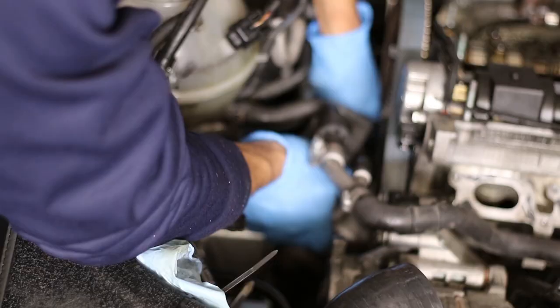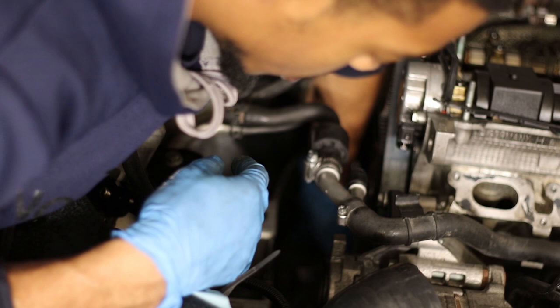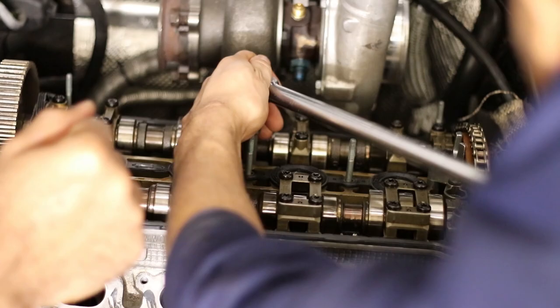That's the motor mount I'm talking about, the one attached to the block. The trick to this, because it took me a while to figure out, is to jack the motor all the way up, then twist and angle it, and it comes right down. I was able to break the bolts loose for the head studs.